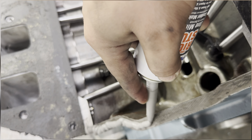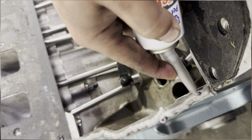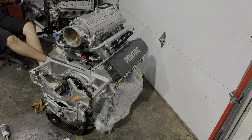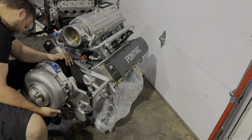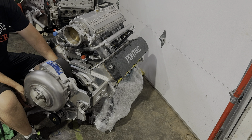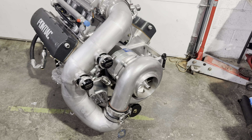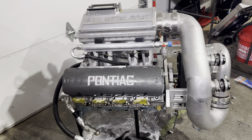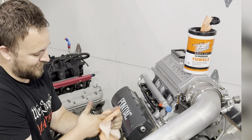It's time to finalize putting the intake on. I'm using another Permatex product — their new 'Right Stuff' RTV silicone. This stuff comes in an aerosol can; you just take the lid off and go to town, which keeps it off your hands. It's also their new gasket maker. It's supposed to be more user-friendly — when you go to take the gasket off it should peel off in one piece versus having to scrape and scrub like older RTV silicone. This motor is starting to look like a motor and I am so daggum excited.